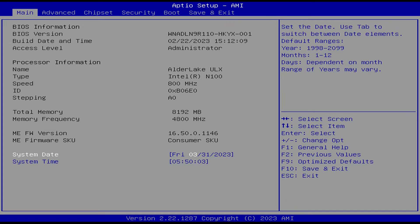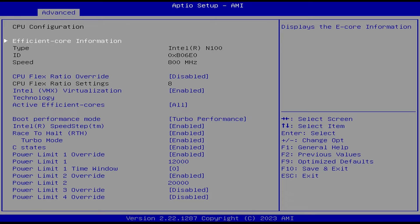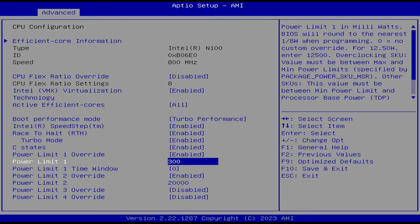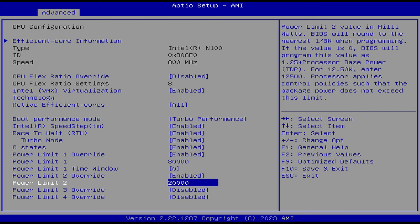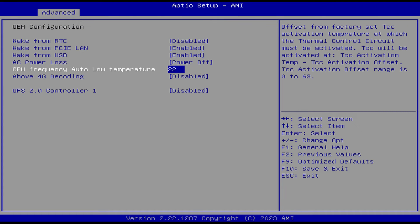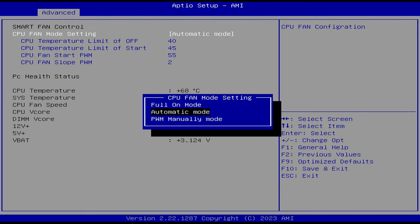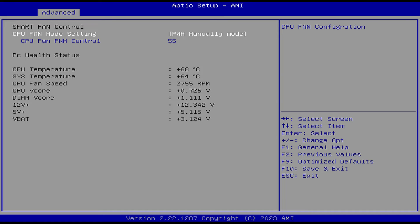I'll show you how to push performance further in the BIOS. In Advanced, head to CPU Configuration. For Power Limit 1, change it to 30 watts — Power Limit 2 can be the same or higher. Next, go to OEM Configuration and set the CPU Frequency Auto Low Temperature to a lower number. This is the setting I didn't change previously, and Topton has chosen to throttle the CPU quickly. A value of 10 or less provided the same result, but I did 5. You can also change the fan setting, although full-on and auto ended up with the same maximum temperature.